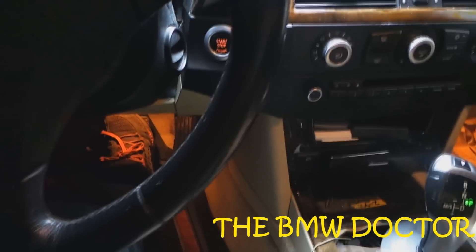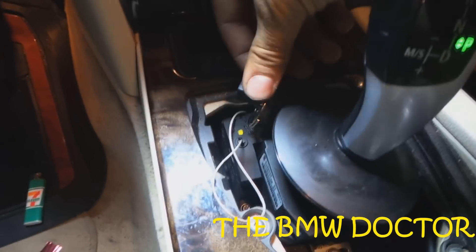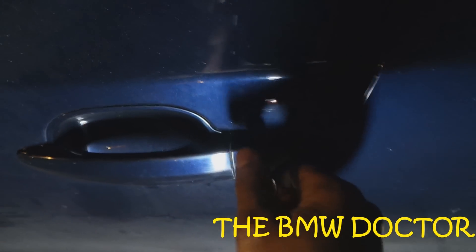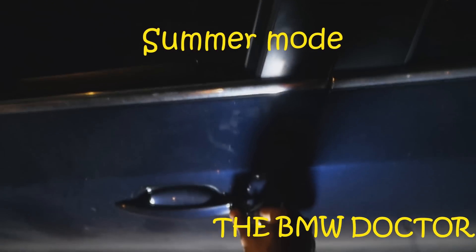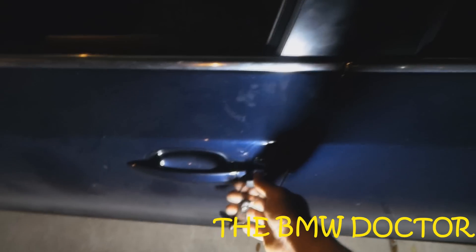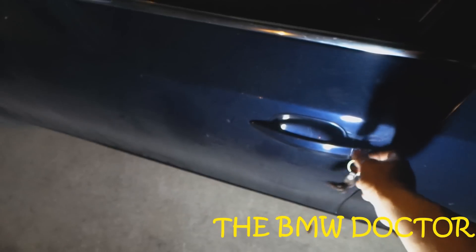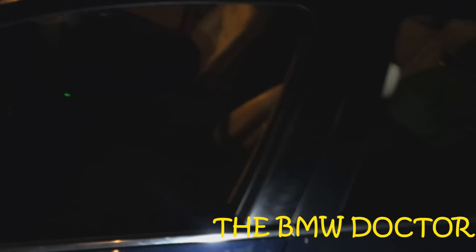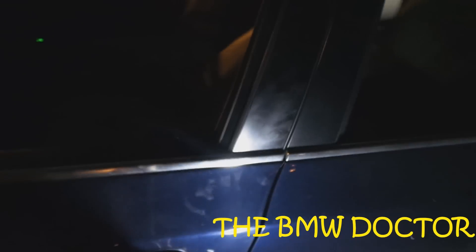The second thing you can do with your key: let's put this back in. Okay, another thing you can do with the key — you're outside, you put the key in and turn it. It's gonna lock the car, and if you keep holding it it will roll up your windows, sunroof, everything. If you go the other way it will roll them down. This is on every Beamer since '97. A lot of people don't know about this. You can roll your windows down with the key if you unlock then hold. For US models it will not roll them up unless you get your system updated or reconfigured with a scan tool.